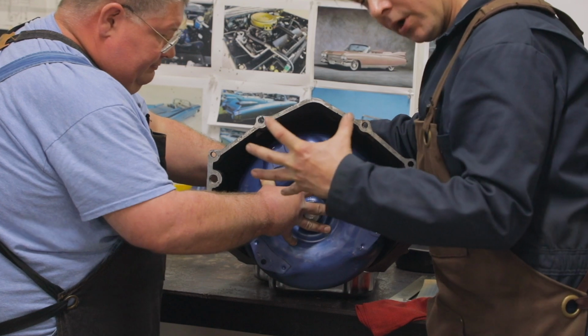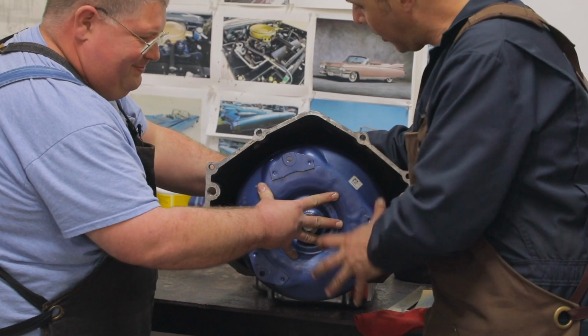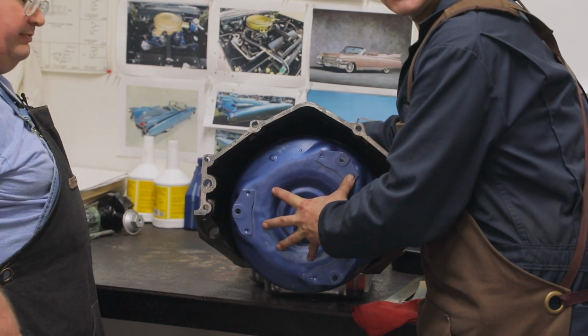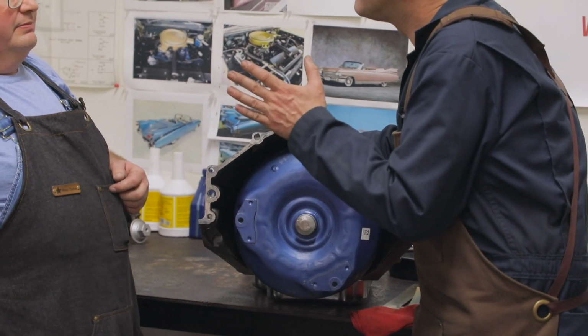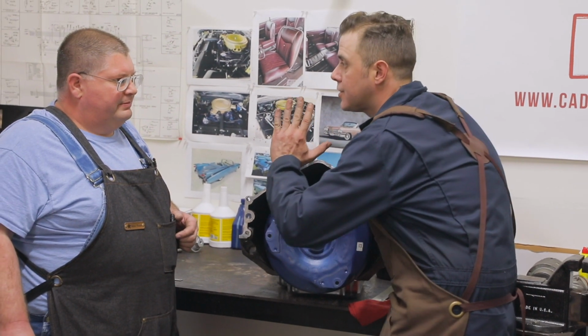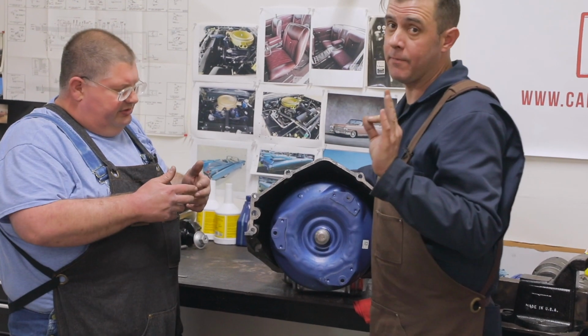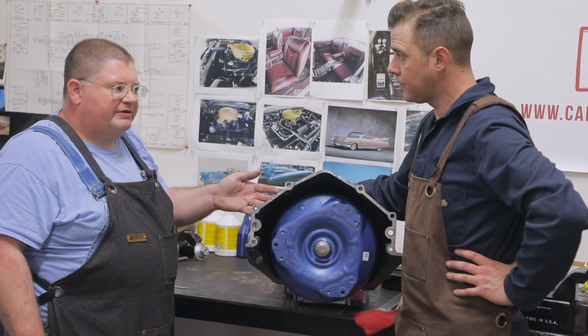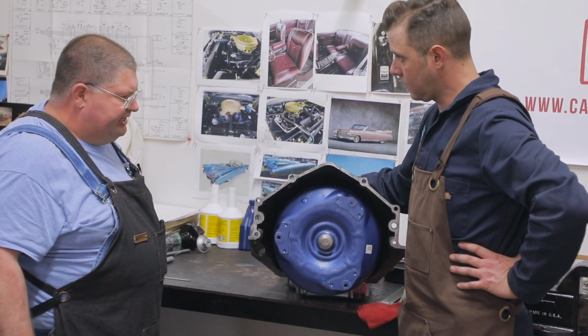So if you put it in, feel it stop, boom. Yep. Turn it with pressure until you feel that last snap. There'll usually be a stop, turn, bang. Yeah, you can feel it. Very important. You have the two spline shafts plus the oil pump drive. So there's multiple things to line up.